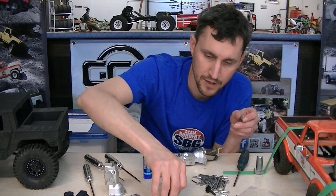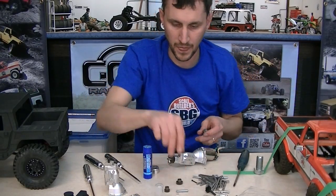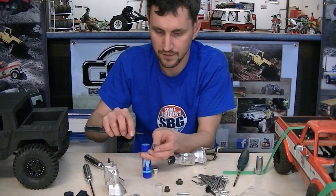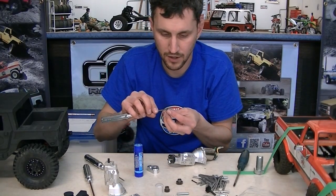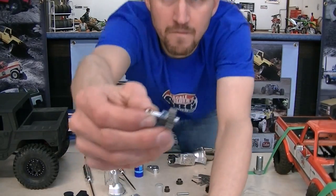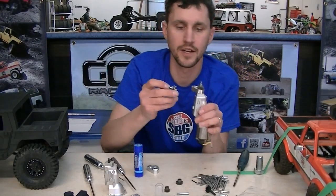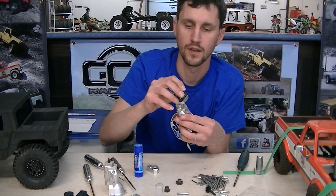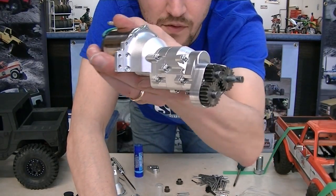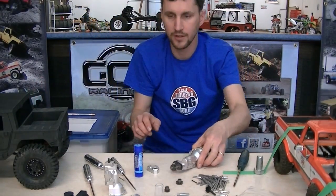Build the bottom shaft using the shaft that has the hole in it plus a flat set screw spot. Take the last big gear and marry those up together - you can't get them on wrong either. Add Loctite, then stab the shaft through the case toward the front of the motor. Now we've got three gears in the case, the front output is showing up here, the rear output is coming out there, and we're going to put some grease on.